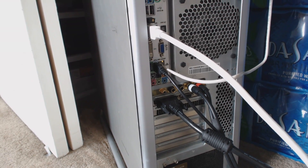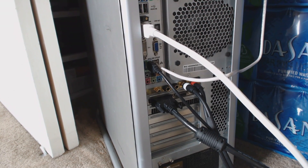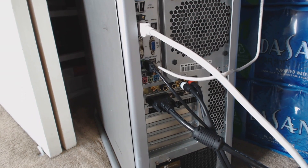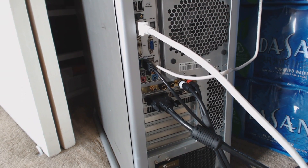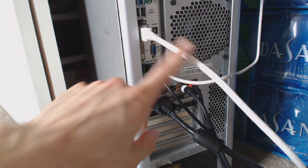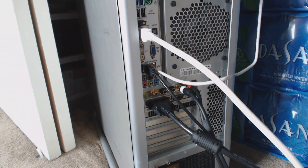In this situation, I would recommend normally having everything driven by your dedicated card, but if you have multiple monitors — like 3 or 4 — and you just can't support that many displays, or in my situation, I wanted to use DisplayPort, which my dedicated card does not support, so I had to use the integrated graphics to do that.